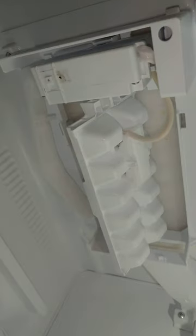The next part is once you slide it in there, you've got to tilt this thing in a certain way because now you've got this piece. This piece is flat and it's keyed in with this particular component because this is the mechanism — this is the motor that turns the whole unit to go around. There's a mechanism right there and you see that motor turns it and that's what would dump the ice.